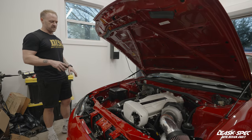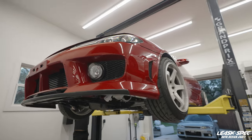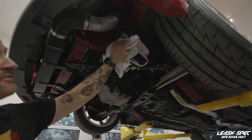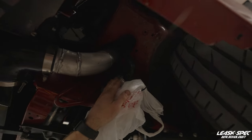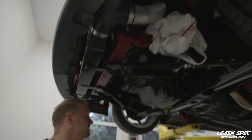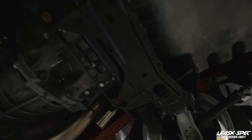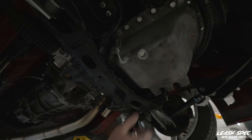Next up, let me show you what we're contending with on the oil pan down below. So underneath the car, this is what we're working with. This is the catch can where the upper passenger side valve cover is feeding into. It's a little bit small in capacity, and that's kind of a problem for these engines — one of the reasons why he wanted to re-approach this and get it fixed. This was just a temporary solution. Second problem is the oil pan. Obviously this is a rear-wheel-drive configuration car, so the differential has been cut off the oil pan itself, and where it was cut off has a slow leak — so that will be the first thing I'm going to address.